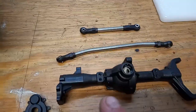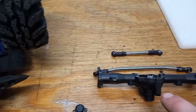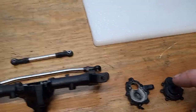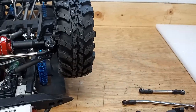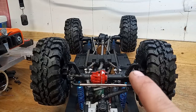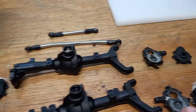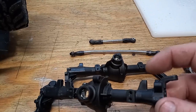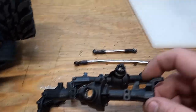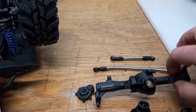These are the way to go, guys. Let me show you what a v1 axle is — this is the original Gen 8 axle. Everything is single shear, you can see the single-sheared setup. Nothing's different from the rear to the front; the axles are identical on v1 and v2. The only difference is they added a bolt to go through here to hold your shock, making the outer c-hub double sheared on the v2 axle.